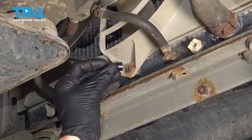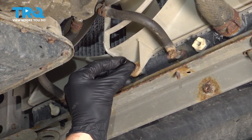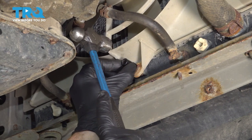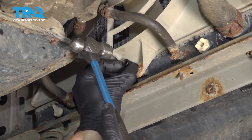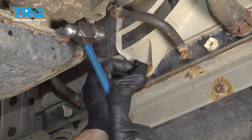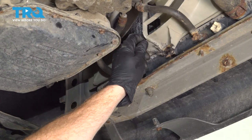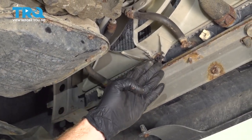We'll look right up here in the center. This bolt should be a 10 millimeter. If it looks like it's stripped out like ours, I'm just gonna use a twisty socket. I'll remove it and then I'll replace the bolt when I go to reinstall. All right, so now that we have that bolt out of there for the lower fan shroud,